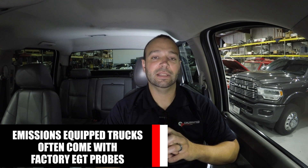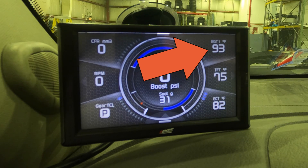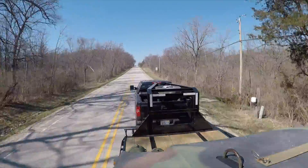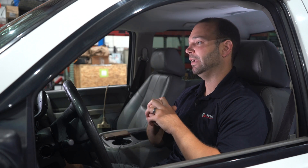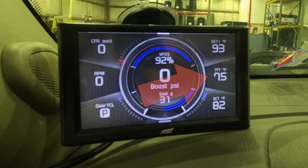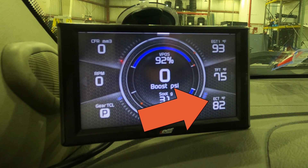On the right-hand side, I have gauges that are the thermal limits for towing. I have EGT1 — our smart EGT back-down is tied to EGT1, so I can see as I'm towing whether we're getting close to that threshold for EGT1 to start backing the fuel rate down. I can look at the upper right-hand corner and the upper left-hand corner, which has the fuel rate, and see how the fuel rate backs down based on EGT performance. Middle is trans-fluid temperature. Anyone towing and working the truck hard is going to be curious about trans-fluid temperature and engine coolant temperature. Yes, those gauges exist on the panel, but I find it easier to look at one set of gauges on the CTS rather than toggling between the dashboard and the CTS.